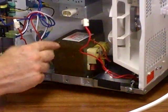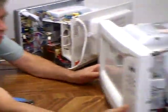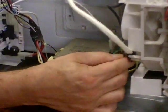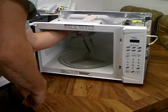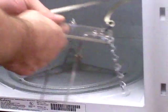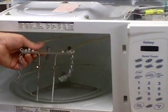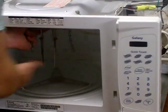The one wire going to the capacitor and the ground are your two power supplies. We remove all this, and in this next machine here — which has the magnetron removed and the power wiring in place — we pull this out and you have a plexiglass plate that is suspended with chains. There are little cup hooks up inside the machine, and you want this unit to be suspended just a little bit off center, with the foot of the bars about an inch off the ground plate.